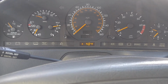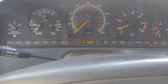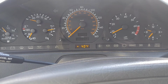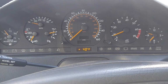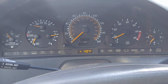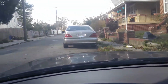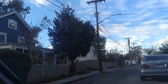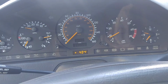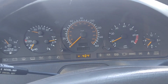The way it runs, it's almost there, but not totally there. So could be a vacuum leak, maybe around the injector seal or something. I had a customer with the same thing where it would just do that. But again, I have no air cleaners, so there could be a wind. As you can see, there's leaves blowing around everywhere, and let's see the tree. So it's quite windy, so it is a possibility that the wind blows under the engine and gets into the mass airflow sensor and throws the reading off. It's extremely sensitive. Even on a diagnostic computer, sometimes you cannot catch that reading fluctuation.